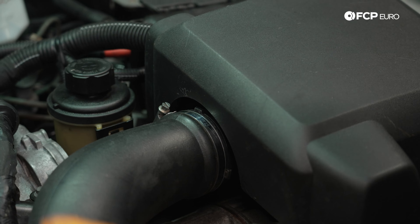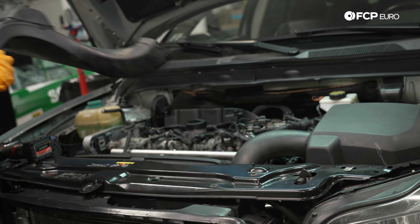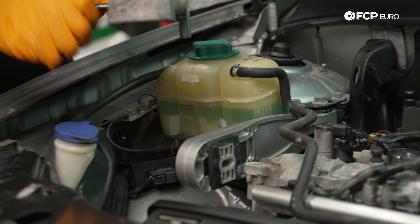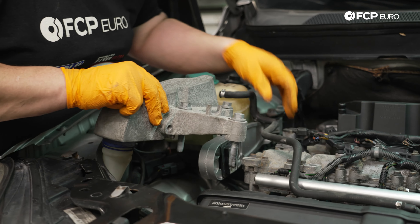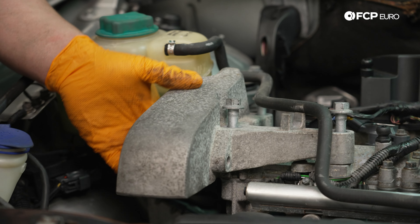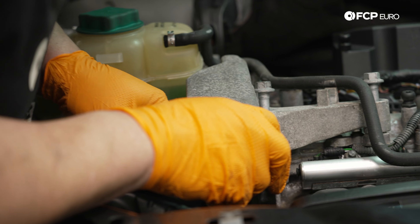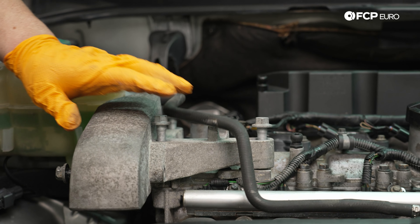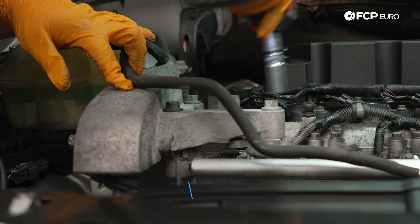Back up top, tighten the intake boot hose clamp once it's properly seated. Reinstall the ducting: zap out the two 10mm bolts, feed it in, make sure it keys into the air box, then secure the two 10mm bolts. Now finish the top engine mount cover — start with the 15mm bolt on the side, then start the other three up top by hand. Snug them up with the impact and torque down. Reinstall the beauty cover.